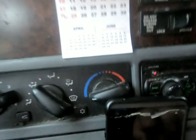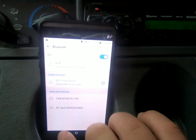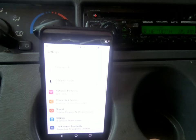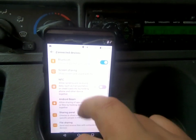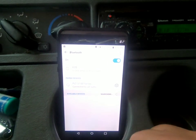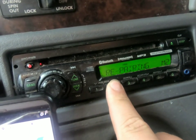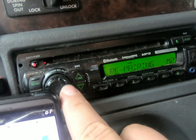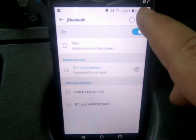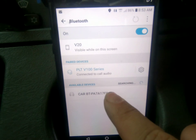First, let's put our phone in discovery mode. Go over here to Settings, then go to Connected Devices, and then Bluetooth. Now we'll put this phone in search mode — that's this little circle up here. Then let's put our radio in discovery mode: I'm going to hold down bank number two — it says 'Pairing' — then I hit the power button to put it on hold so it gives it some time.